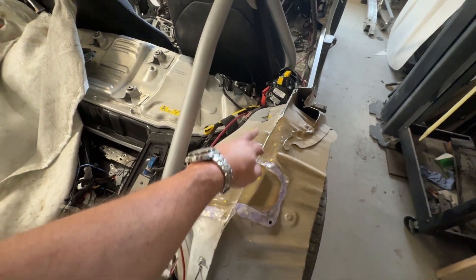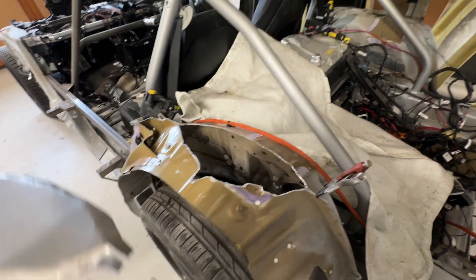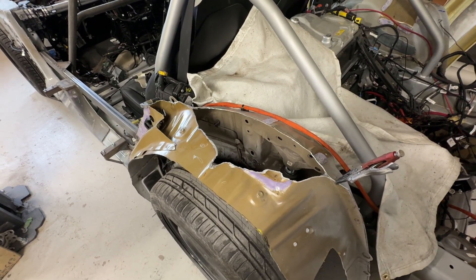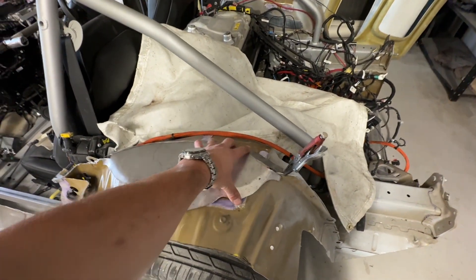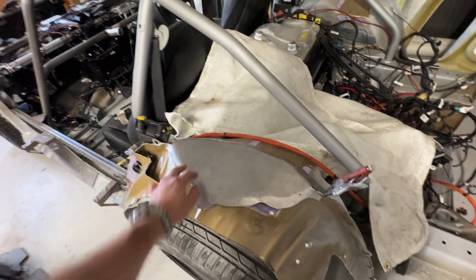After I chopped the top off and sort of beat them down a bit, what I did was take the laser - with the body on - I marked about an inch down, so that's a slightly angled plane from the horizontal, and then this sheet I'm going to form, bond and rivet onto the top so I've got a nice flat surface.